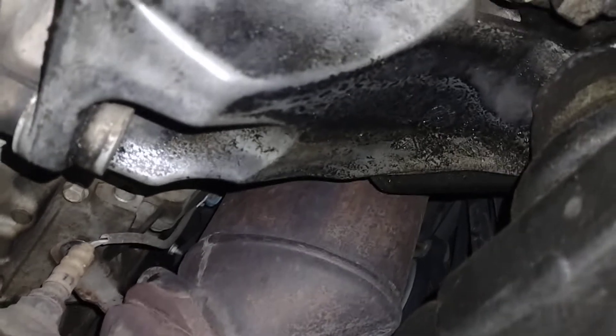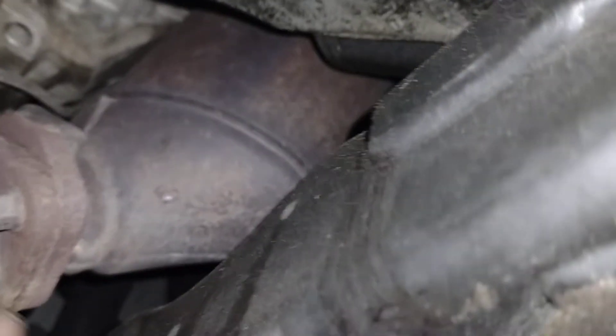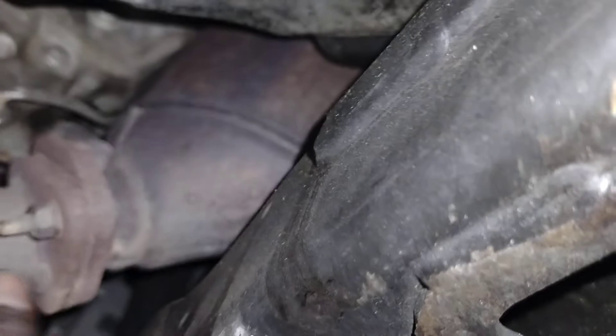I'm gonna get it done today so tomorrow I can just chill. You got three bolts on the top side and two on the bottom. Best to PB Blast it, but I got lucky — this stuff is coming right off. Using my impact, and one thing: when you start that impact, don't stop, just keep going till it comes off, because if you get a bump in it that's how you'll break the bolt. It's two 13mms on the bottom and three 15mms on the top. The heat shield had three 10mms up top. This is your boy Boss Man — make sure y'all like, subscribe, and comment.